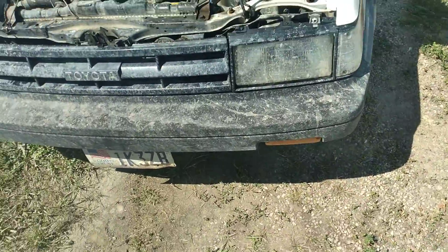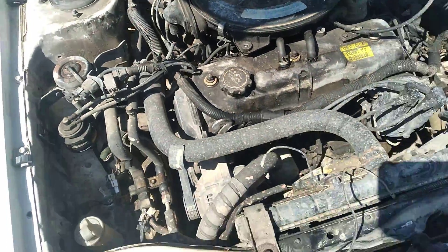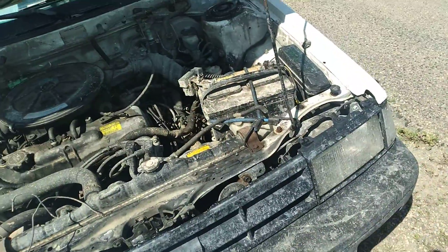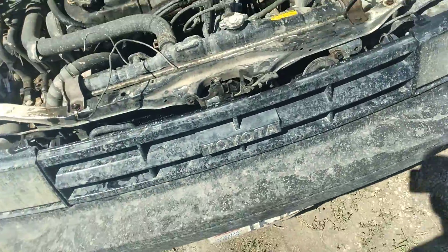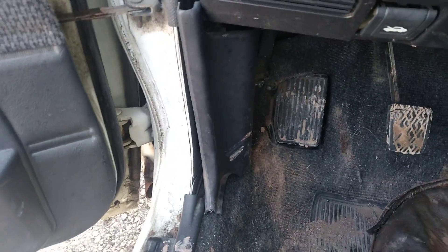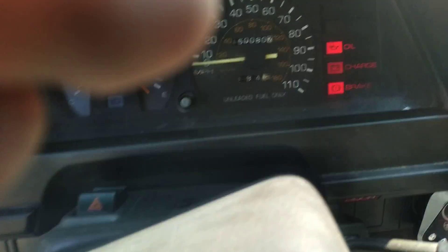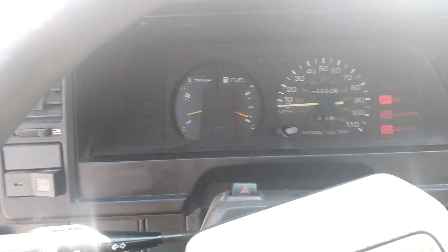What I had to do was put a new alternator on it — that didn't work, it wouldn't charge. I could be driving down the road and it would lose all power and just shut off. Thought it was the alternator, put a new one in, didn't help. Found out there's a fuse under the hood for the alternator charge light — it was blown, and that was causing it not to charge. Replaced that fuse.